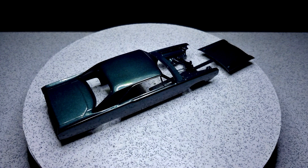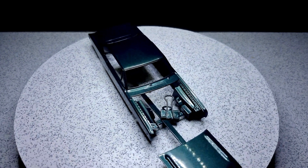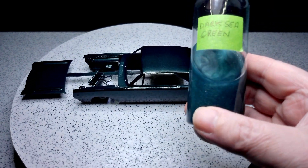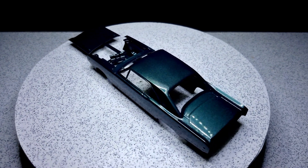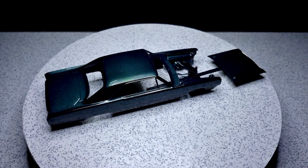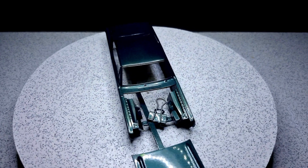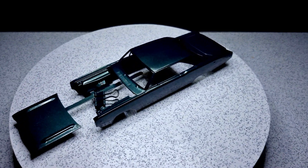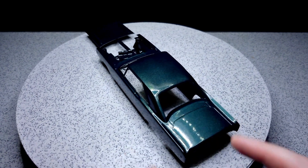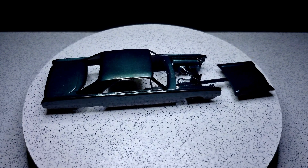This is how it turned out — it is going to need a good buffing. So there is three coats of that Dark Sea Green pearl. There are a few fisheyes on the top of the roof but we will be able to flatten those out. We got it done about an hour ago so I am just going to leave it until tomorrow morning before we start flattening it all down. It is going to look well I think with a white stripe over the trunk lid and then with our chrome work around it.